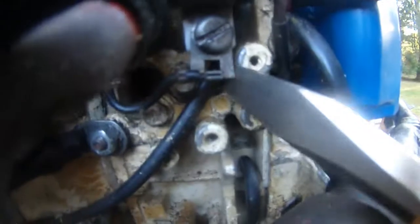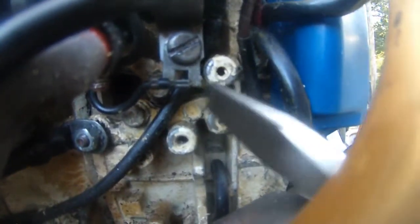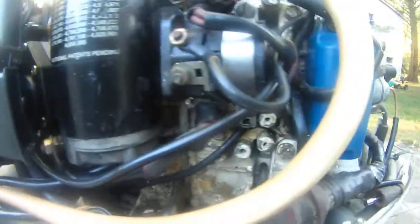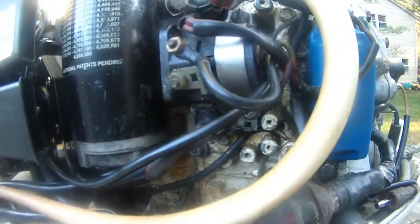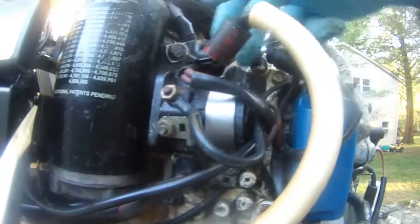So this is the connector — I didn't really connect this to the ground very well, and that's why the solenoid went off. The starting motor was not responsible. So that should fix the problem. This is the starting motor, and behind this red power line is the solenoid.